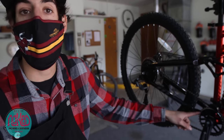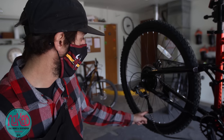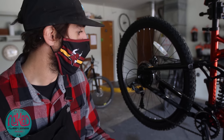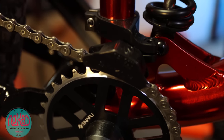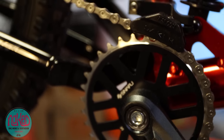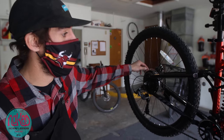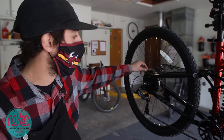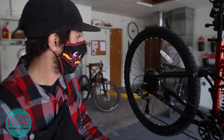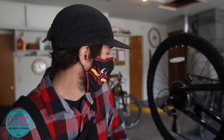Derailleur? Yeah, no clutch, so you're going to hear this a lot. This is not a narrow wide chainring to keep the chain on. So in combination of the non-clutched derailleur and a non-narrow wide chainring, that is a concern, but there is a chain guide right here. I don't know how well that's going to work. The dork disc. Normally we would throw these off right away, break them off. But in this case, I think it might be the day saver once that chain falls off into the spokes. I mean, the thing that's probably going to hold up the best, honestly, is probably the saddle.